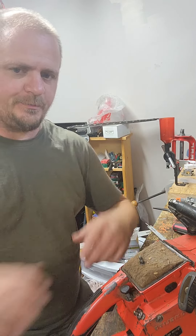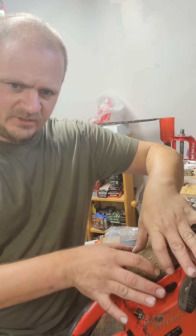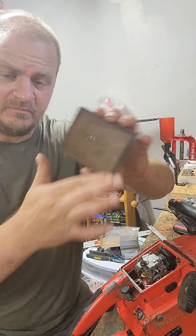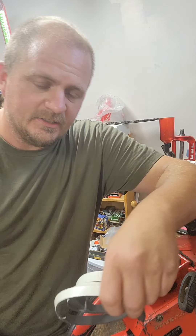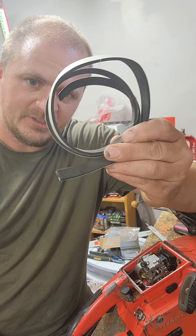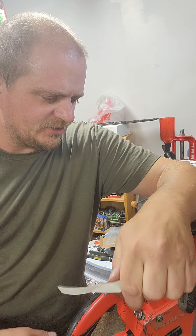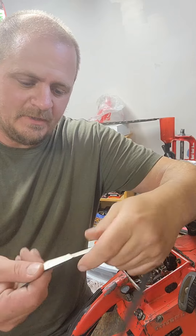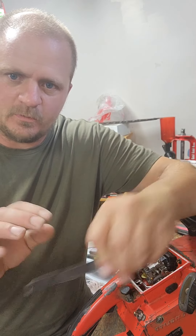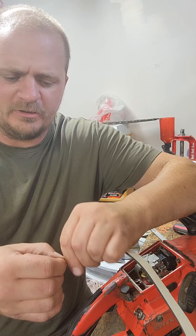What I do for this — I've seen people painstakingly cut out cork gaskets that follow this shape, and that'll work. But the easiest thing I find is neoprene gasket. We used this stuff at work when we built toolboxes and shipped them for sealing things up. It's cheap, and it's self-adhesive on one side, so once you put it on it stays there. But you can rip it off easily too if you want to redo it.